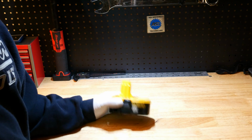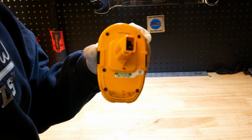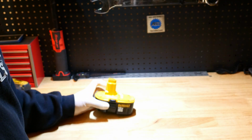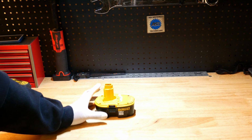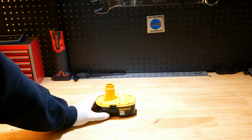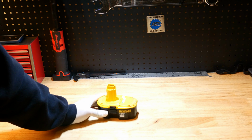So the best thing to do is to take a power tool with you and just find the polarity in advance, like I usually do, and I'll mark it on the tool, where's the hot and ground before you get there. You can find that by using a voltmeter to check the polarity. So you get there and you can jump those components and make sure they work. I'll give you a quick example. I don't have a fuel pump or anything like that here that I could power up, but I do have a cheap scan tool I'll power up for you off of this battery.